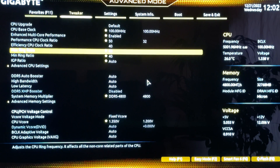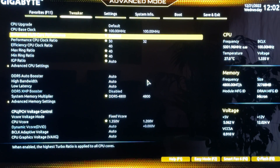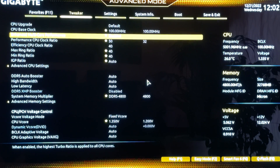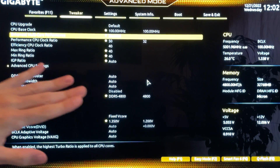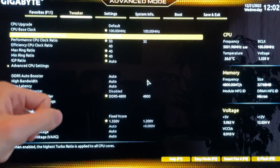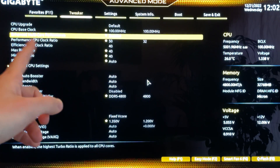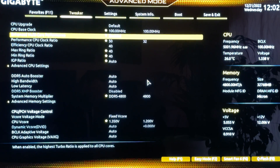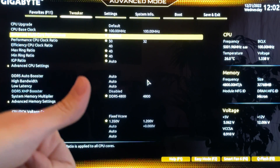When you come into the BIOS, the first thing you want to do — as in every overclocking guide — is unlock all the turbo boost performance. Find something called Enhanced Multi-Core Performance, or similar depending on your motherboard. Find all the power limits and set them to the absolute maximum. Long Duration Power Limit: set it to 99999. Short Duration: same — unlock everything.